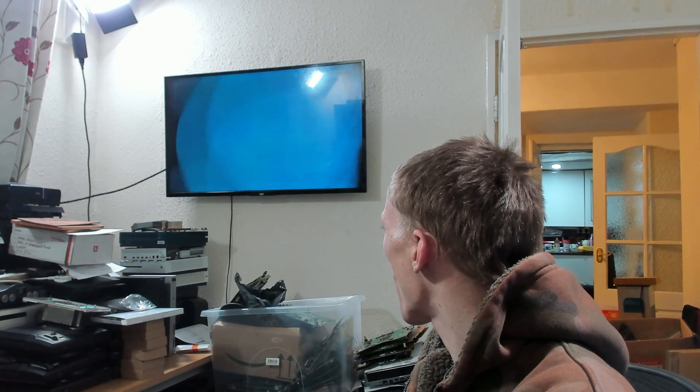One thing I'm going to try before calling it a no-display is just cleaning the HDMI cable to make sure. That could have been flux in the port — and I think that could be all that's wrong with this. I think someone's written this off for flux in the port. I know this has had an HDMI replacement because I can tell by the solder joints and the fact that it's a V2 port. That's unbelievable — it's syncing a controller now, which is pretty nuts.